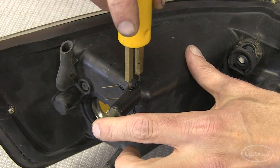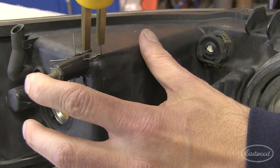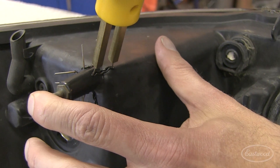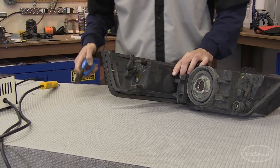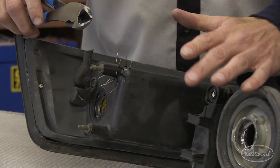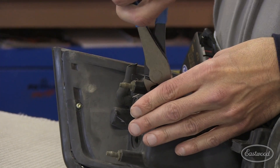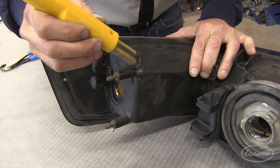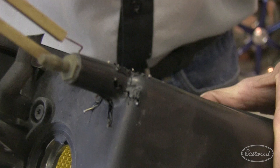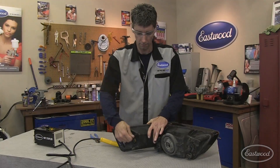What I like to do is give it a little twist to lock it in, then release. Now you take a pair of diagonal cutters, like these from Channel Lock — watch your eyes, wear eye protection — and snip off each staple at the base. Here's a neat little trick: you can smooth out the plastic with a heated wire. On some applications, this is a good start before you begin sanding and priming. The repair is complete, and now it's ready to go back into the car.